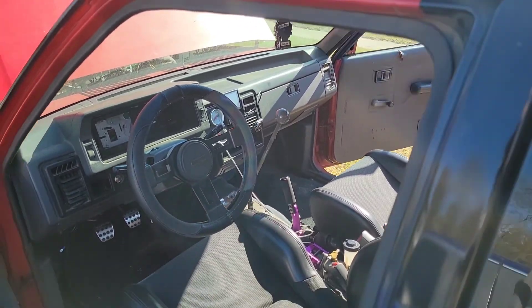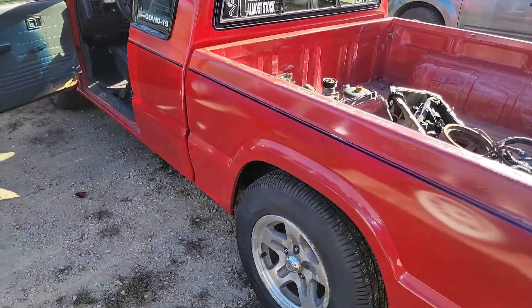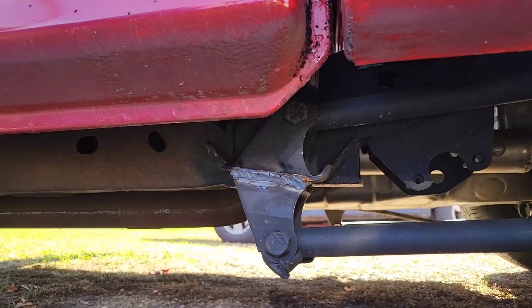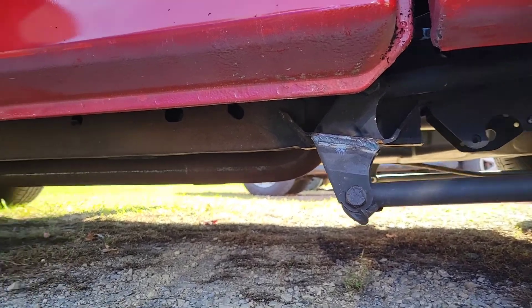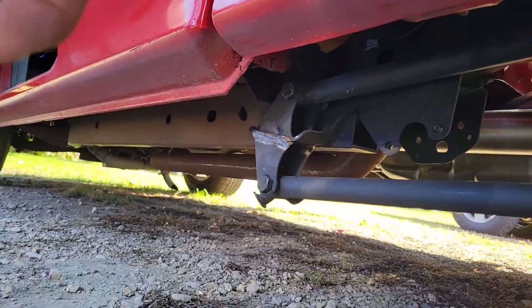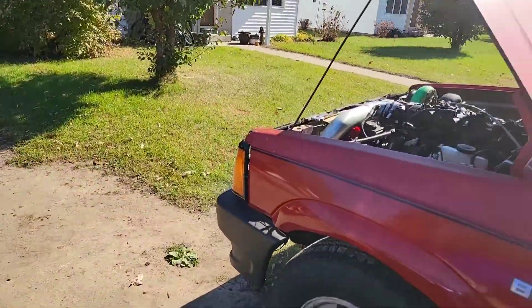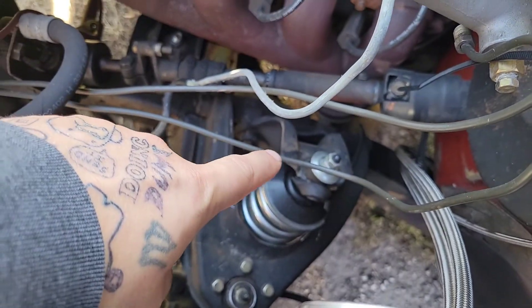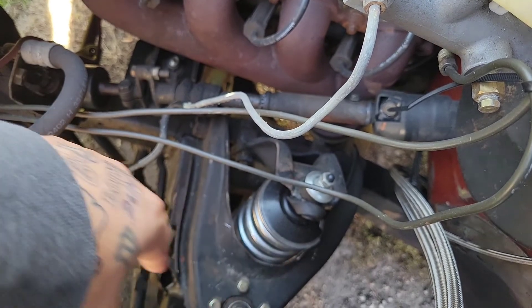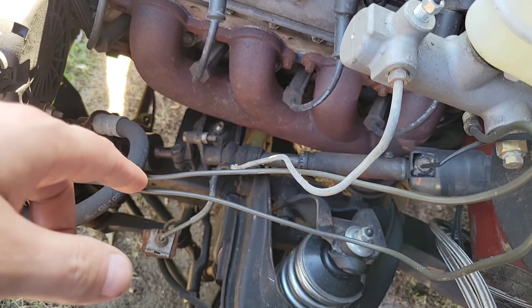Basically I'll be flipping these. I need to go to Garage List and he is going to help me with new bracketry here, since this is all twisting and ripping off the frame. We'll do a body mount, and we'll gusset the front up here. I want to fix all this where I plate it in, bring it out a little bit, get a cup for this stuff to sit in, grind these down and reinforce them.